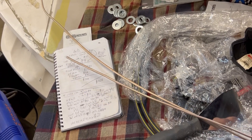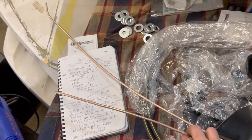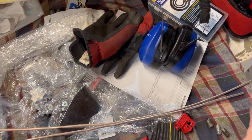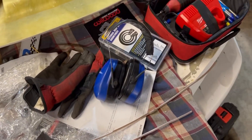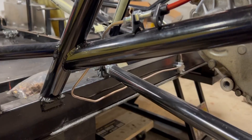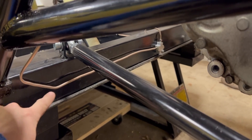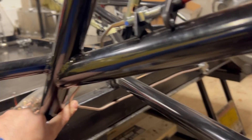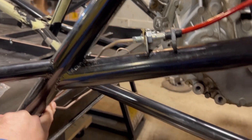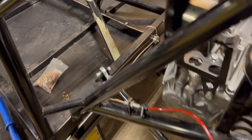Actually I think I am going to be able to use the Nicopp. This line right here is the one I screwed up on the front that I got slag on — I thought it was going to be too short, so I cut off the screwed-up ends and measured it. We're at about 31.5 inches and I need one that's 31 so it's going to work out perfect. And what I had left over from the roll is 40 inches so I think we're good for the rear. It's really cutting it close — it's probably a half inch too short to route it ideally so I had to go with a 45-degree angle there, but it still clears everything.